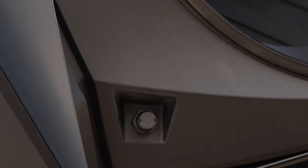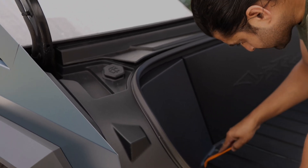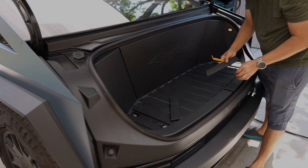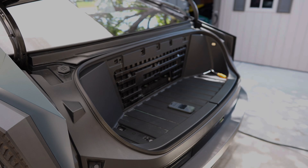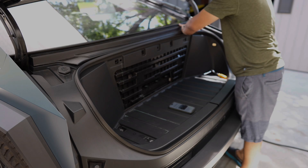So how do we do that? First, we remove these plastic caps right here. You just twist and pull — there's one on each side — and a windshield washer fluid cap that can be removed just by gently pulling it up and it should pop right off. Second, you remove these covers that I just did right now and place them aside. They are different for each side and they say right and left on them, so you don't mix them up.